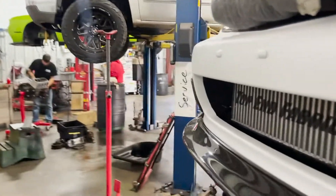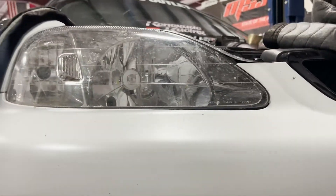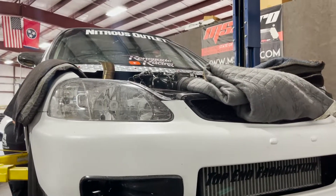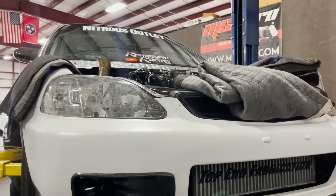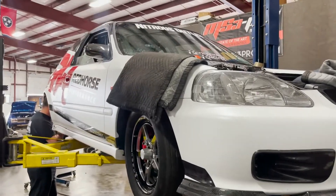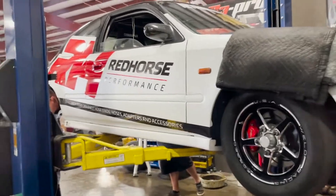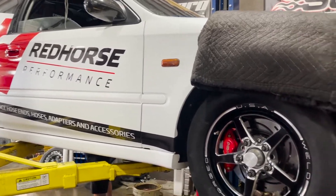So if a lot of y'all don't know a little about the car - the new engine in it is a 427, it's a Dart-based engine. It's got LSX GMPP heads on it, 76-78 millimeter Precision turbos. It's got a Nitrous Outlet kit on it - it's a direct port, dry shot. It's all data-logged from a Pro Max controller. Nitrous is primarily controlled by the Holley. It's got twin tanks in it - the carbon fiber tanks. They literally weigh nothing.